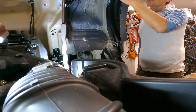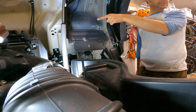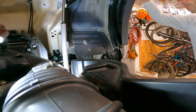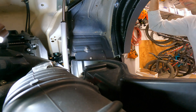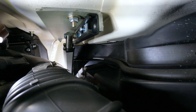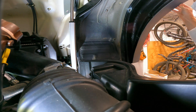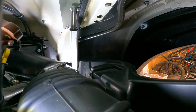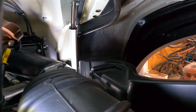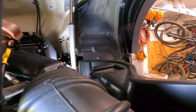The roller on that track has a stop on both ends. I adjusted the stops so the cab stops from opening just before the actual factory latch locks it into the locked open position. The idea is to hold it up just before that locks, so it never really has to be locked and won't get damaged if it doesn't get managed. This required some trial and error raising and lowering the cab just to get that setting right.